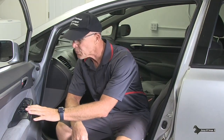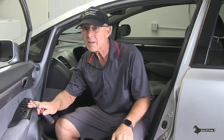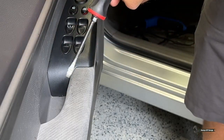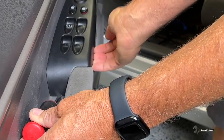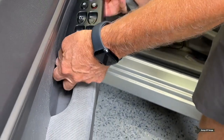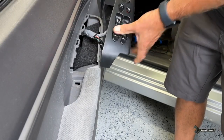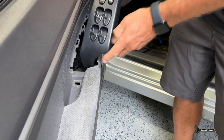I'll be doing all my tests right here at the window switch. Let me show you how the window switch comes out of the door panel. You'll need a flat blade screwdriver. Hopefully you can see right here at the window switch there's a little tab. Just take your flat blade screwdriver, sneak it in here, twist it as you're pulling up right here, and then your window switch will come out. Right here there's actually a kind of a hook which hooks right into here, and on the other side there's a tab that goes into here.